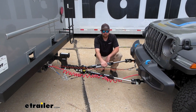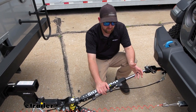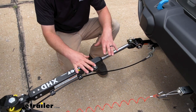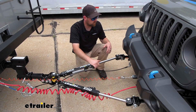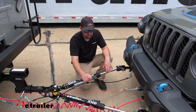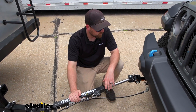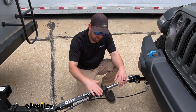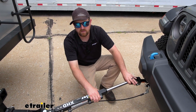This is a non-binding type tow bar, and regardless of which tow bar you go with, I always suggest getting a non-binding one. It has these levers, and if the arm gets in a bind, you can push on these and it'll release all that tension. A lot of times when you're driving, these will get locked into place, and then you go to disconnect on uneven ground and try to pull the pins out and everything's super tight. With a binding type tow bar, it's a big pain — you have to get a special tool or a hammer. The non-binding feature saves you that time and headache. Push on the lever, it releases the tension and allows you to easily disconnect.